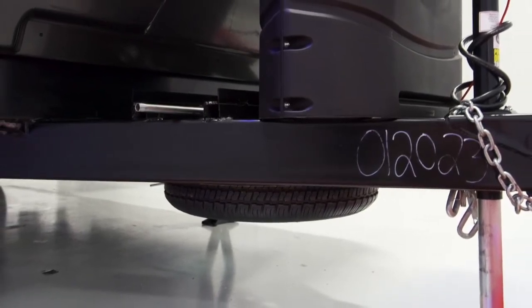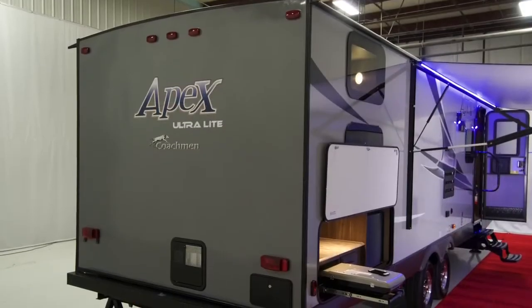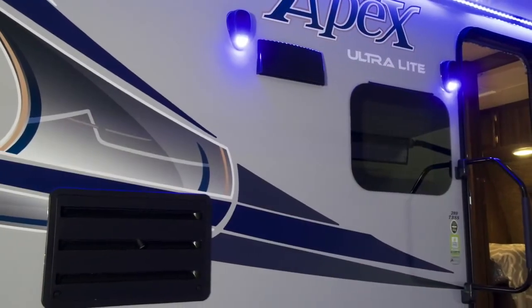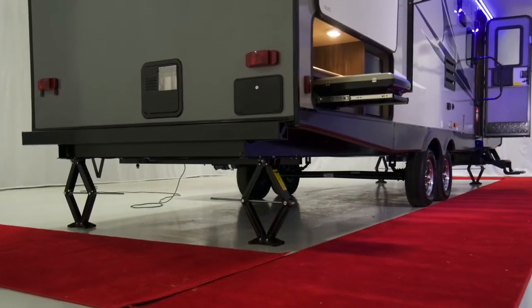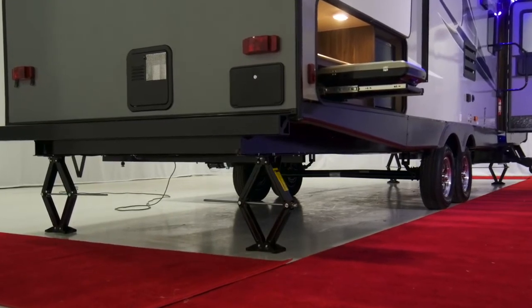You are also probably noticing the location of our spare tire. When you mount a spare tire to the back, you dramatically increase the downforce weight on your bumper and frame every time you hit a bump. By putting it up front, we take away that downforce and level out your ride for less wear and tear on the coach, and equally as important, prevent the unit from porpoising as you drive down the road.